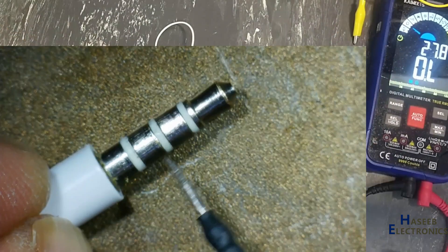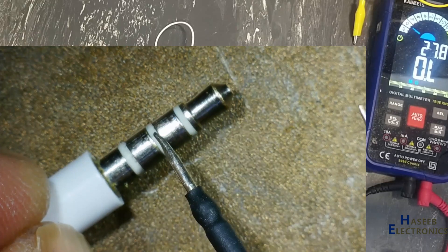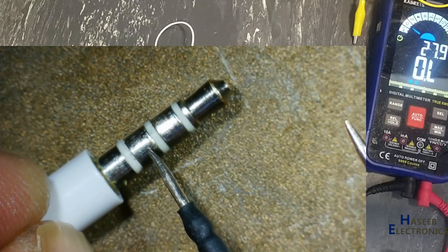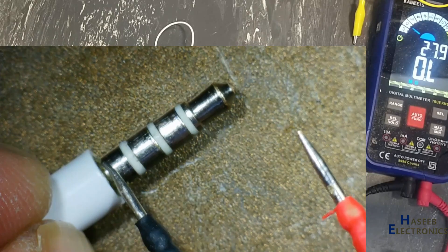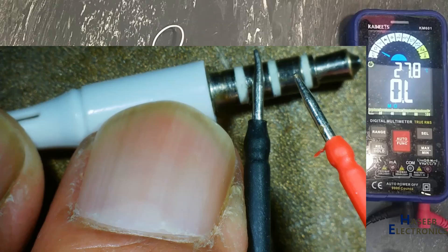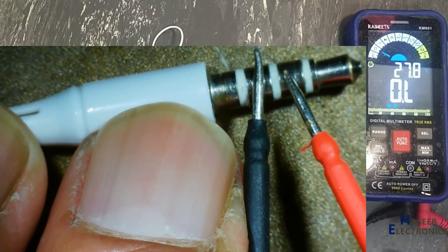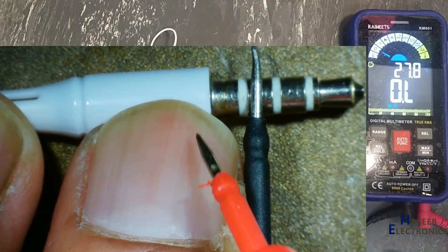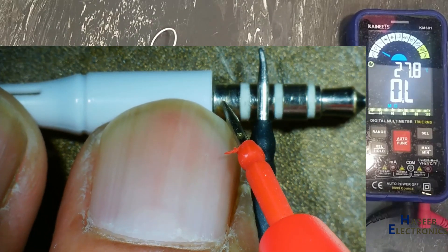Let's see what's wrong here. One speaker here, second speaker here, common wire here — that is the ground or common wire. Microphone here. Set multimeter to resistance, negative lead at common. First ring pin — microphone — no indication.